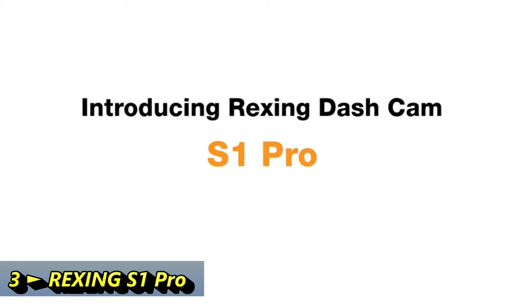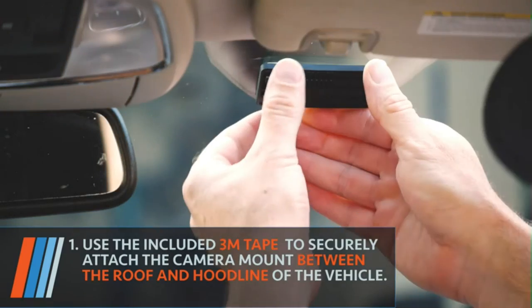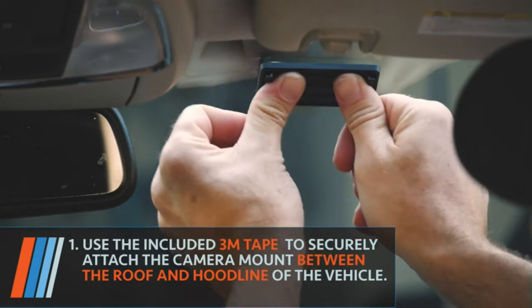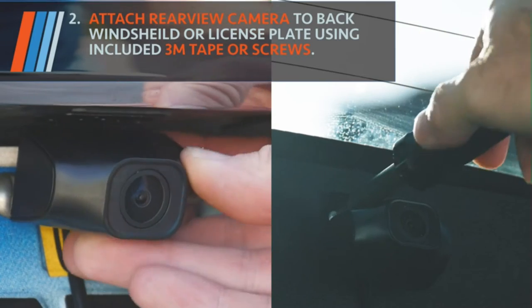Introducing the Rexing S1 Pro Dashcam. First, place the included 3M tape onto the back of the camera mount. Orient the mount squarely between the roof and hood line of the vehicle, and press firmly for 20 seconds to attach to the windshield. Attach the rear camera to the rear view of the car using the included 3M tape